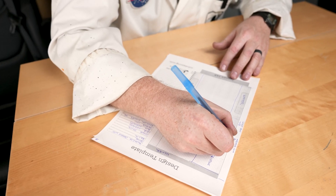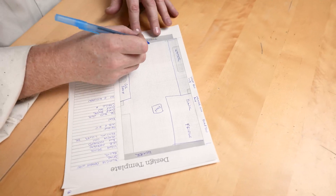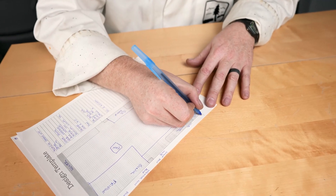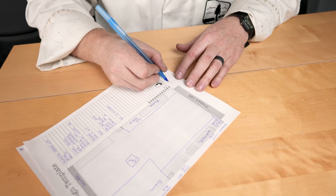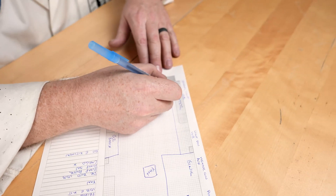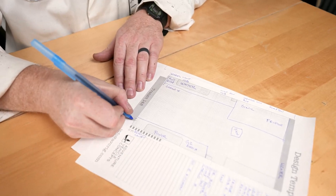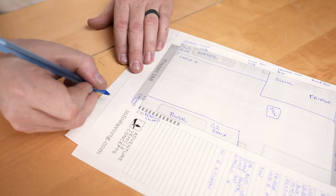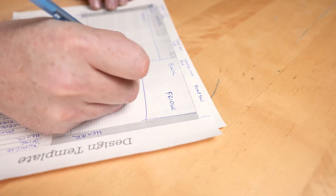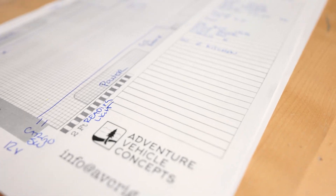I always run an auxiliary. We also have a pump switch going up there. In the back, next to our water cabinet, we're gonna have our water pump. We're gonna want a USB at our bed and a reading light at the back, and also a reading light on our passenger side. The one I always forget is our cargo crossover — that's for our cargo lights on our utilities. At the back of the van I'm gonna need my cargo light switch. I like to add a 12-volt here as well to pump up paddleboards and things like that. In the front of my kitchen I'm gonna have a 110 outlet and a USB outlet, and of course our vehicle charge wire.